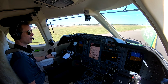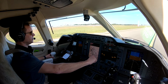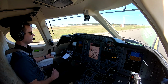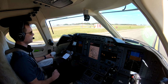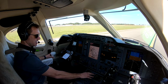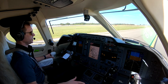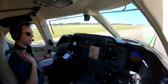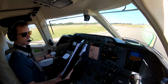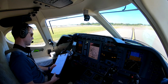And we were getting a bleed over heat. Every time I would turn the heat up in the cabin, I would get big red flashing lights on my panel here saying that you're overheating something. You better turn it down before you melt something down or whatever. So the airplane wasn't heating right. I guess I didn't notice it before because it's been kind of cool outside, but I feel it now, it's a lot colder in the cockpit now too. So it was a bad temperature controller. Basically, the little computer box that all the thermostats talk to, there's 3 main thermostats in the airplane, and they all talk to this temperature controller box. But I can really feel the change now. It's blowing some really cold air that it wasn't blowing before, so this is great.